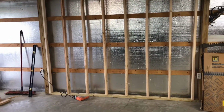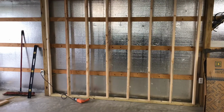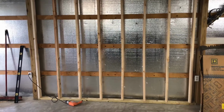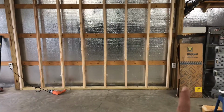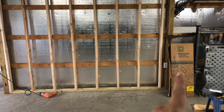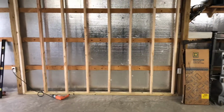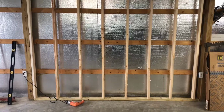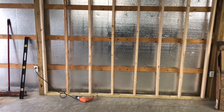They run over to an adjacent building where we have another sub panel put in. So I don't actually have a sub panel over here. It's just those 2 circuits. I've got this framed out because the electrician's going to install this 40 circuit 200 amp panel. We're going to have another 200 amp electrical service put in here, so that I can have welders and my compressor over here and not in the other building.